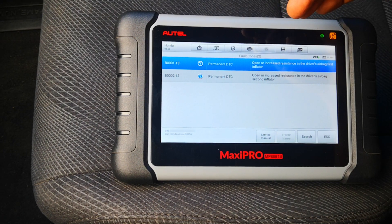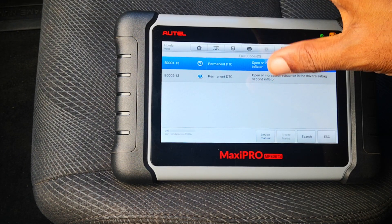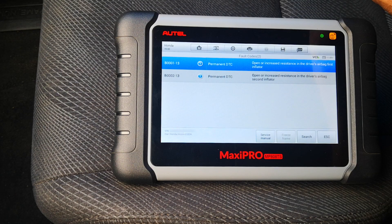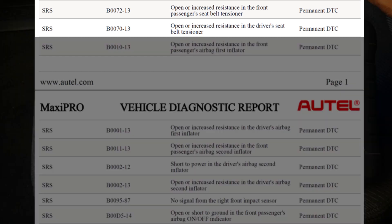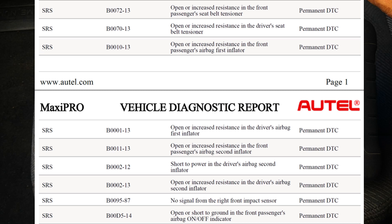This is very good news — it minimizes the number of components I need to replace. It also tells me the occupant was not wearing a seat belt, and that there was no one in the front passenger seat. For comparison, here's an SRS scan report from a previous car where both passenger and driver seat belt pretensioners deployed as well as the airbags, and the right front impact sensor was also likely damaged. These days many manufacturers say crash sensors reset automatically after an accident — no need to replace unless the sensor itself is damaged — and a good scan tool will detect any defective crash sensors.